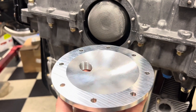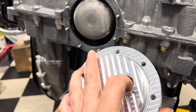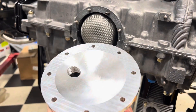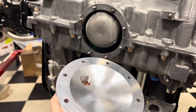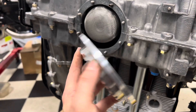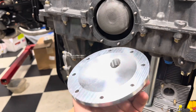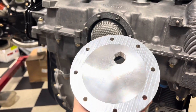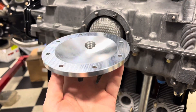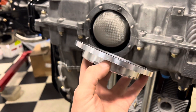Way back when, Porsche put in a sump plate — you can see the little concave dish-out area there. Well, the sump plate they made for the '77, '78 turbos didn't have a drain plug in it. So we're all kind of forced to go out into the world and find sump plates. Now, it used to be a buddy of mine, Aaron Burnham, made these, and they were absolutely fantastic. Aaron has found bigger and better things to do, so he's not making those anymore. So I got this one from LN Engineering.